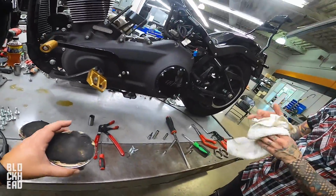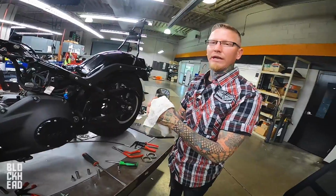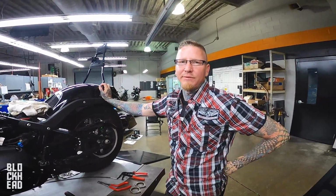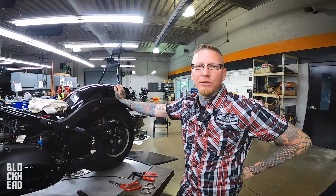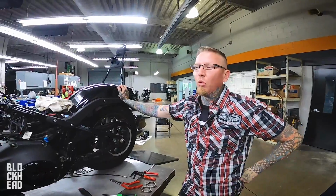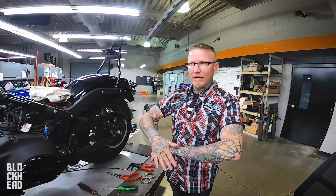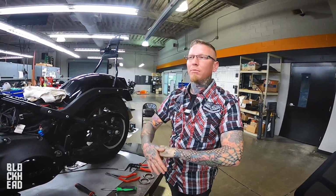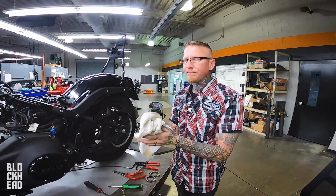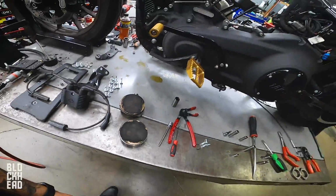It's very abrasive. And so to avoid that, you were saying to run basically ethanol-free gas. You can run ethanol-free gas every day of the week. What was the combination you recommend? Ethanol-free plus avgas, if you're running a high compression engine or you have pinging problems. Run unleaded gas and then put about a quarter tank of avgas into your tank of unleaded. Avgas is clean, doesn't have any ethanol, doesn't have any byproduct in it. So anytime you can run pure gasoline, in any vehicle you own. There you go, tips to keep your pistons clean.